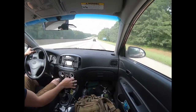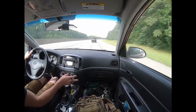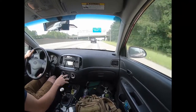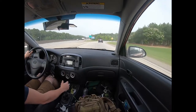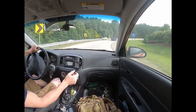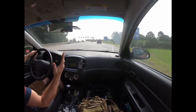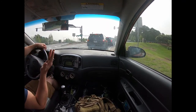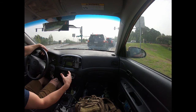It is by far the sketchiest setup as far as suspension goes, but somehow it works. It actually works really well, like almost some of the parts were created for it, because as you physically lower the front end, it actually cambers the front tires in the right way. Now I need to put on some limiting straps, I believe, so the springs don't bounce out. But when you turn to full lock, they're actually straight up and down, so you get full contact with the tread at full lock, as opposed to normal cars, where you don't usually get 100% full tread, which is the purpose of front wheel camber. Rear wheel camber, I couldn't tell you.